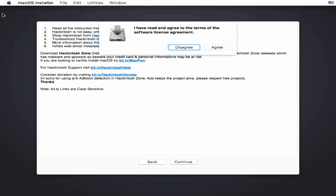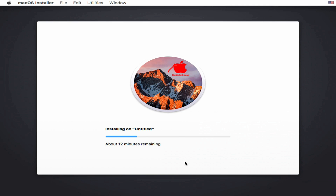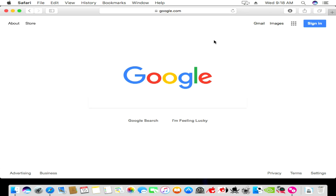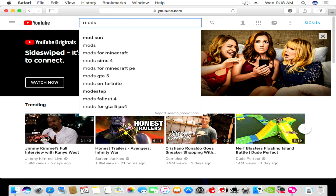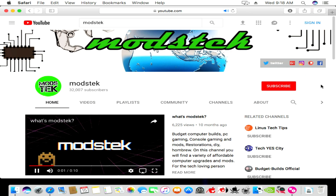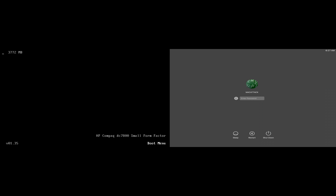I'll leave some links in the description in case the Hackintosh software catches your eye. And even though I've had Sierra and High Sierra running on here buttery smooth, I just don't have a compatible graphics card. I've tried NVIDIA GT 1030, NVIDIA GT 730, and ATI Radeon HD 7450 with no avail, greatly reducing my chances to use Final Cut Pro or even a non-glitchy game of chess. Maybe I have to drop down to a lower OS like Mountain Lion, or maybe you know how to fix it — if so, drop a comment. I could use the help. Thanks.